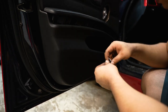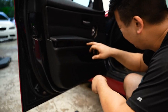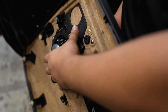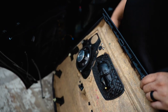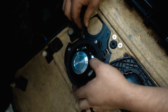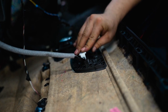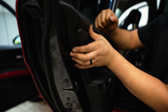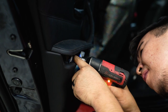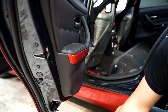Now that's on, last step is just — in my case — only two hardware screws. For most people it's going to be three: one here, one here, one over here. Then I just have to get the cover and put it on. So here's the back — same thing. Spacers, hardware, same process. Put the new harness on, connect it to the OEM, and then put the door card back on. Then just the window switch on this side and it goes on. Last step is just the hardware. That's how the door card is put back on.